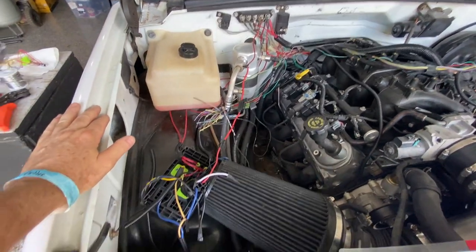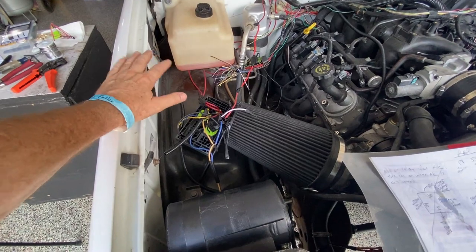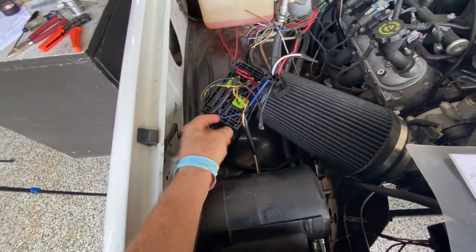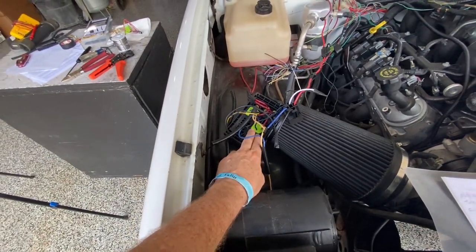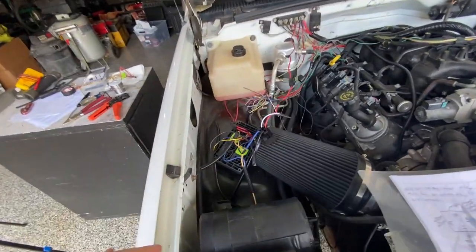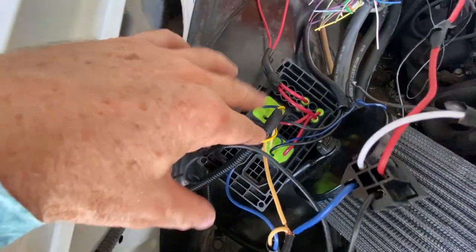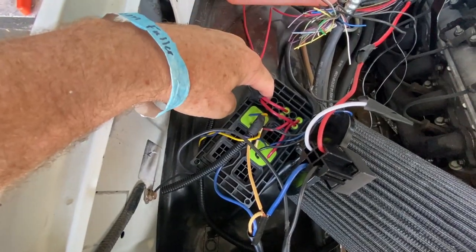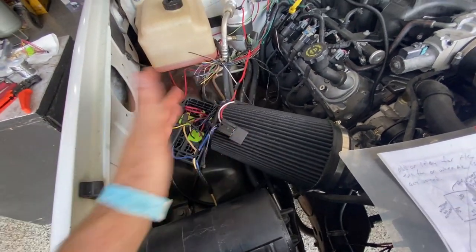I believe I've labeled all that correctly. I've got to get it looking pretty — solder all my joints, use marine heat shrink to seal those connections really well. I'll be taking this relay and putting it inside the box. This is the bottom side of the box that was mounted on the fender well. I'll be putting it inside along with that 30-amp fuse on the other side. When I get it all looking pretty and put back together, I'll show you what that looks like mounted. Currently that relay box shows two relays — these are for the fans with 30-amp fuses each. When I come back you'll see there will be a third fuse and a third relay for the fan to come on when the AC is activated.